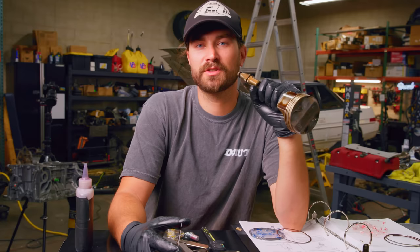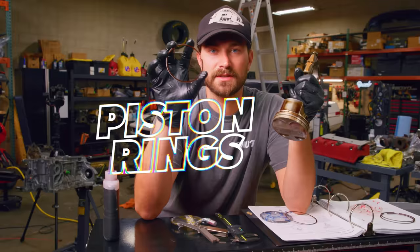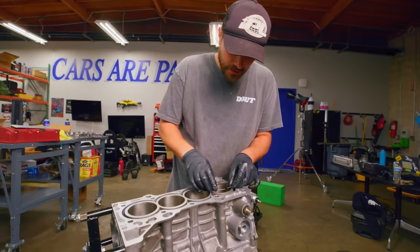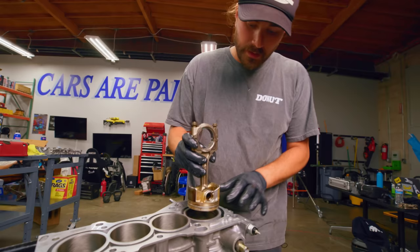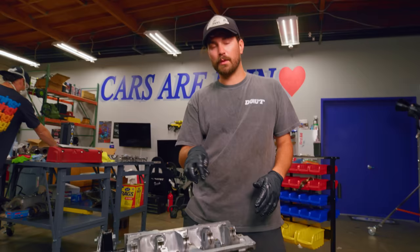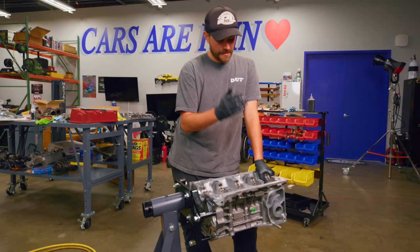The first thing we're doing in terms of reassembling this engine is putting in new piston rings. These are spec rings for the engine, so hopefully we won't have to do any filing, but we're going to measure to make sure. What we're measuring is called the end gap — the gap between the two ends of the piston ring when it's installed in the cylinder. We'll use the piston itself to push the ring down flat and safely, then measure the end gap with a set of feeler gauges. We're looking for the gauge to fit with a light amount of resistance. That piston ring measures out great.